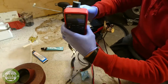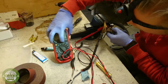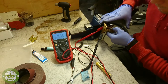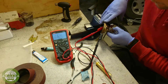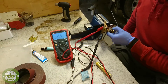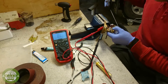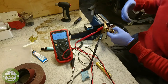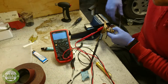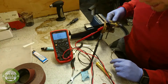I've got the multimeter hooked up to the sender. I actually realized something — I lied to you guys before. This is full tank; zero resistance is full tank. My tank is going to look like it's empty a little bit earlier than it actually is empty, with the float all the way down. So now I'll cut the spring, put the plate back on, test it again, and if it's good we're done.